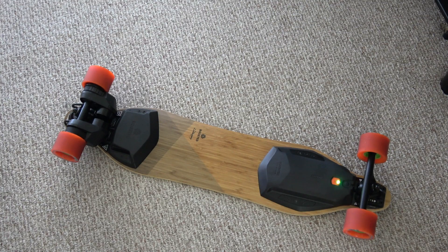The other thing I do that goes along with cleaning and maintenance is I run the board upside down a little bit to see if I hear anything abnormal. I'll turn the boosted board on, get my remote, and run it at low speed — also run it in reverse — to make sure I don't hear any clicking. I examine the back structure of the motor mounts and belts to see if anything's wobbling and listen for any clicks or rattles. As you can hear, it sounds extremely smooth — that's what I'm looking for. For those that don't know: if you have the remote and the board on and want to turn it off, roll completely back on the throttle and then hold down the power button, and that'll turn both the remote and the board off automatically.